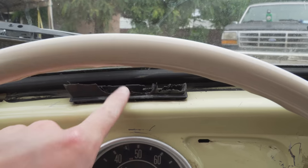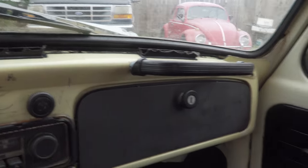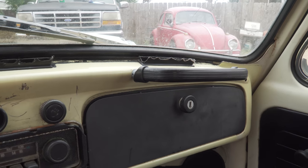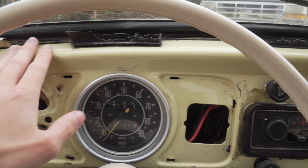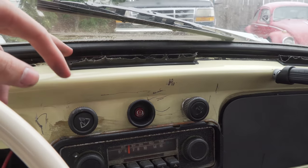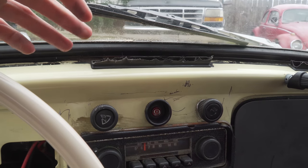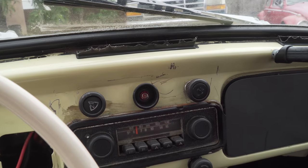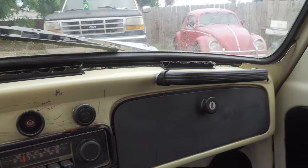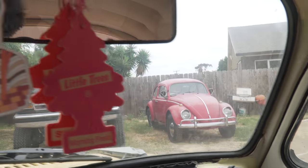The next thing you'll notice are these little plastic vents in the dash, and these currently look terrible — I think they got snapped off when the dash got removed. In Europe in '68, '69, and '70 they still did metal dashes but had these vents, so you can buy ones made to have a metal dash with this plastic vent. I may end up doing that, but first I'm going to try and just take a dremel and get these down flat and see if it looks decent. If it does I'll run that, but if not I'll just have to end up ordering some.